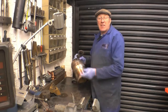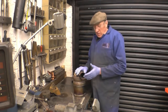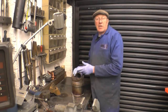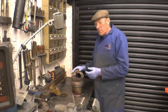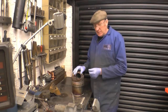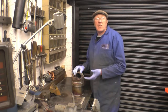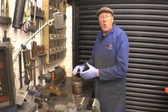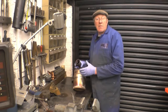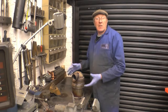There are sensors before and after — you've got a differential pressure sensor that senses the pressure difference between the inlet and the outlet. Once the inlet pressure gets too high, that means the filter's starting to block. What it does then is put a warning light on — the DPF warning light. The idea is you drive the car at motorway speeds for 10 or 15 minutes. The engine also injects more fuel to make it run hotter — this gets hot, red hot in fact — which then burns off all the carbon and soot, and your filter starts to work again.